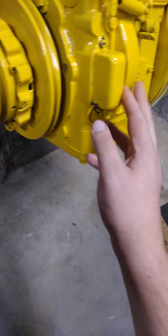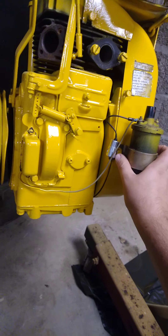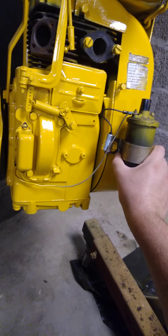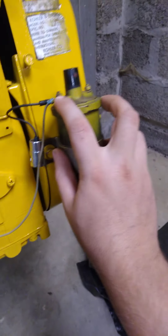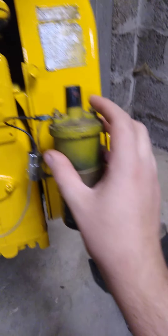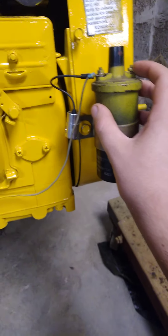These are your coils — there is a brand new capacitor. Always make sure it's grounded; there's exposed metal. Both your points and your condenser go on the negative side of the coil. On the positive side of your coil is where your ignition from your key goes.